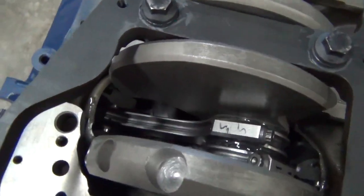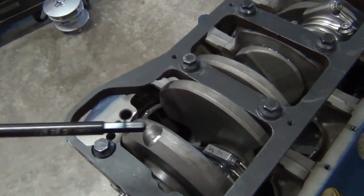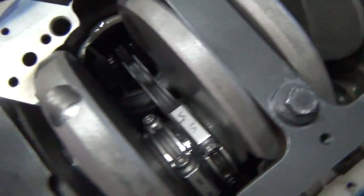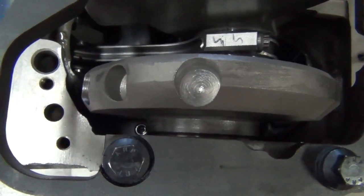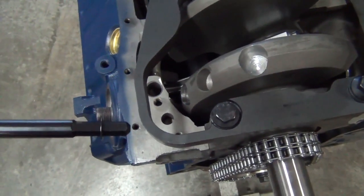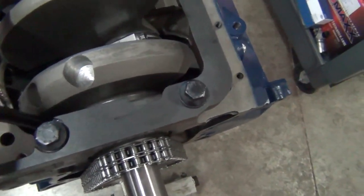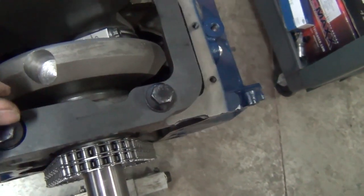The other thing you want to do is look at the oil pump shaft — it's got a little lock washer on it that's adjustable. You can see down that round area where the distributor is sticking down into the block and the shaft fits down in there. You want to sit that all the way down. The reason that washer is there is so if you pull the distributor out from the top, this rod won't come out with it — because if it comes up from the top you'll have a hard time getting it back into the distributor.